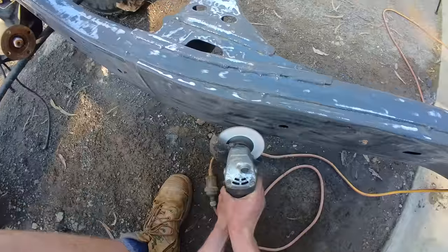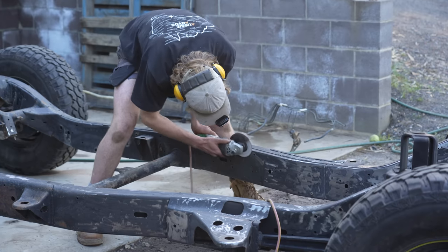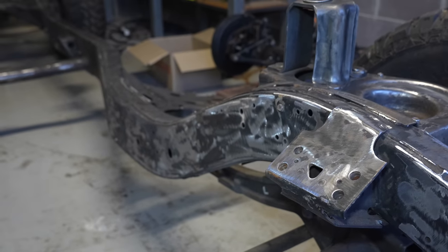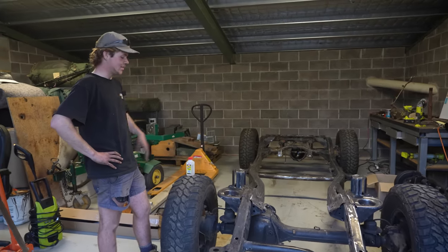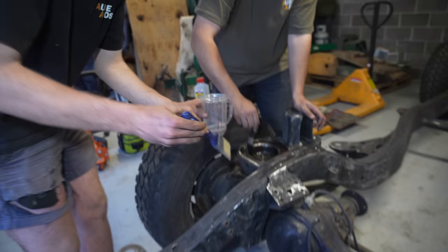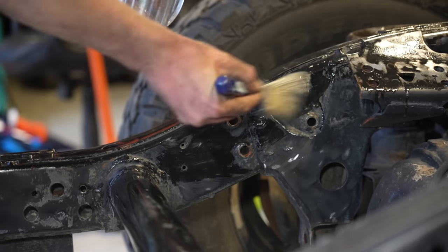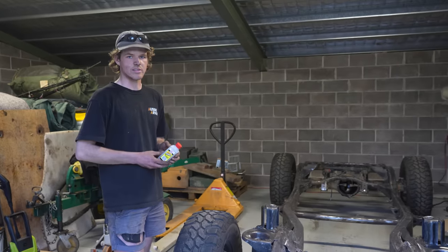When it came to wire wheeling the chassis there was actually a lot of surface area to cover, so luckily I had a mate give me a hand and between the two of us on the grinders we made a pretty quick job of it. We've managed to get most of the chassis ground back — obviously not all back to bare metal, just trying to get off the majority of that paint and any surface rust. At end of day I'm putting some rust converter on the bits we've done — this will eat away any small or light rust still there and protect the exposed metal until it's ready to be painted. I'll go over it with a brush and cover the whole lot, then let it sit overnight.